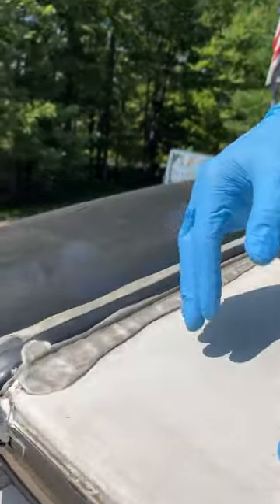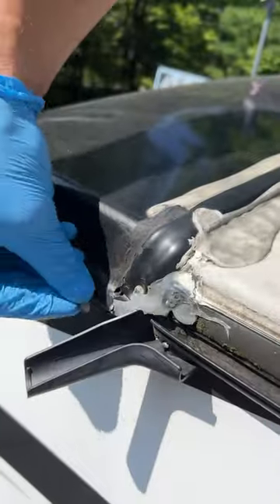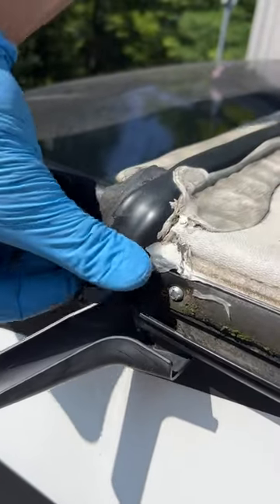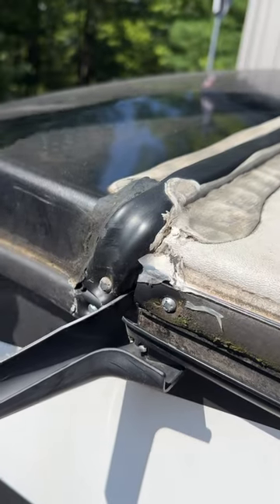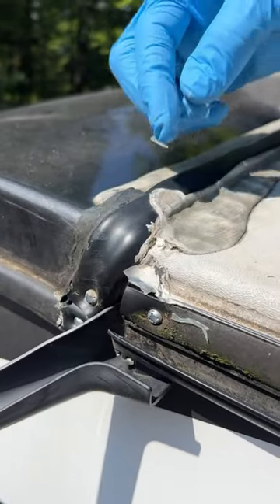Let me show you on the corners of the RV what you're looking for and what sealant to use. First off, don't use silicone on the outside of the RV because if you can peel it off like this, it's not stuck very good to the RV. The only places you'll use silicone is on the inside of the RV, typically the bathroom. Sometimes on windows on the outside of the RV, but that's pretty rare.